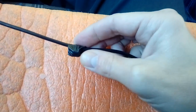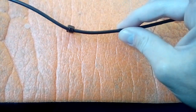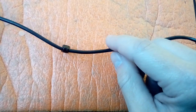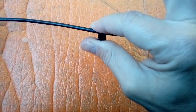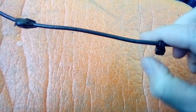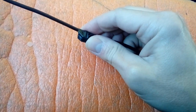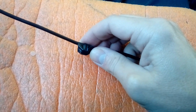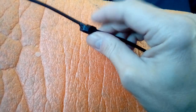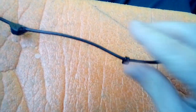Cable tie wrapped around the cable, slip the excess off, and cover it in electrical tape. What this is for is when you tuck this up above your headlining — the cable's quite thin, and if you hit a pothole it's possible for the cable to drop down across the windscreen while you're driving. This bulks the cable out a bit so it stays put above the windscreen. I cover them in tape because cable ties can have sharp edges once snipped, and your headlining is made of a cloth or fibre substance that could get rubbed over time. Go ahead and cover all three in tape.